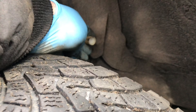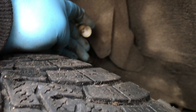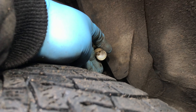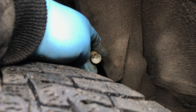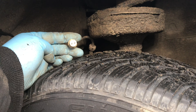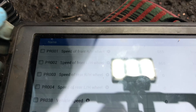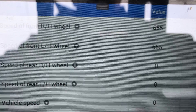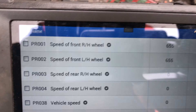I've pinned into the two wires on that bit there — it's hard to get a shot of this. I don't even get the wheel signal, and I've got a ground on one side but only about 0.6 volts on the other side, which is worrying. But sometimes the computer doesn't turn it off, so we'll go and check the other side. I pulled out the driver's side and you can see that indeed it went to 655 — so that proved the point, the other side is open circuited.